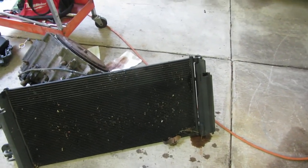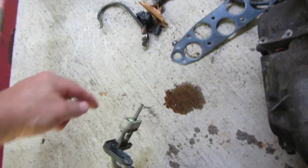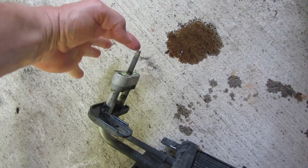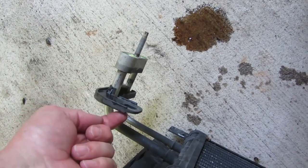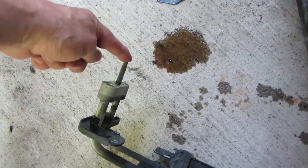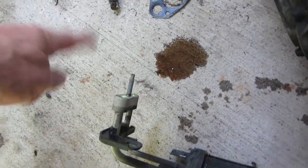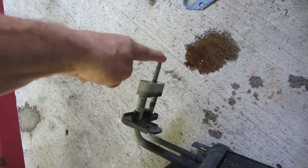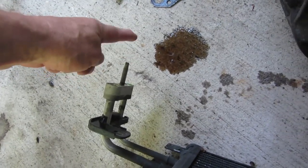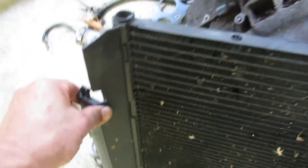I've been slacking on the filming because I've been in there working. So inside, underneath, you've got a stud with a 13mm nut on there, and the lines go in. This bracket gets bolted to the radiator with a 10mm bolt — that's going to go back on the new one. I'm going to take this stud out because it does have the outside Torx fitting, so I'm going to use that stud instead. People say put that on after you put it in, but it came out easy enough, so I think I'm just going to put it on the new one before I put it in. These plastic pieces here will go on the new one as well — that's for air diversion.